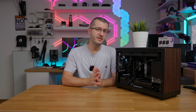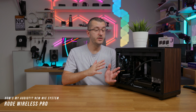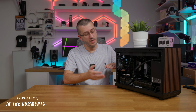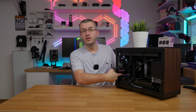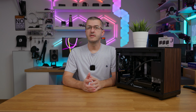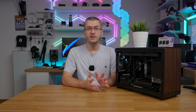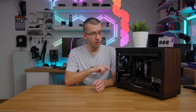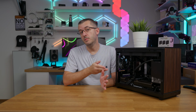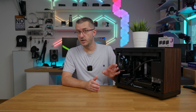So let me explain this. There are different micro ATX boards on the market. Some will have the first PCI slot lower, like the one I use here. It moves the GPU one slot lower, so you have this slot here empty. But this is also limiting the use of bottom fans, at least the regular ones, as it again depends on the GPU thickness. So possibly thinner cards can fit with the lower PCI slot position and bottom fans, the regular 25mm ones, or perhaps 15mm slim ones, or none, like in my case, since this GPU is real thick.